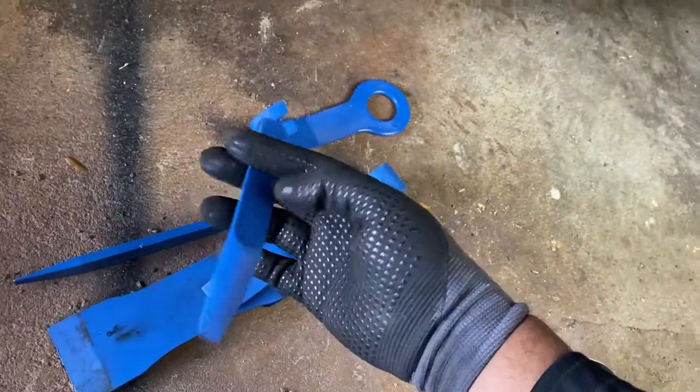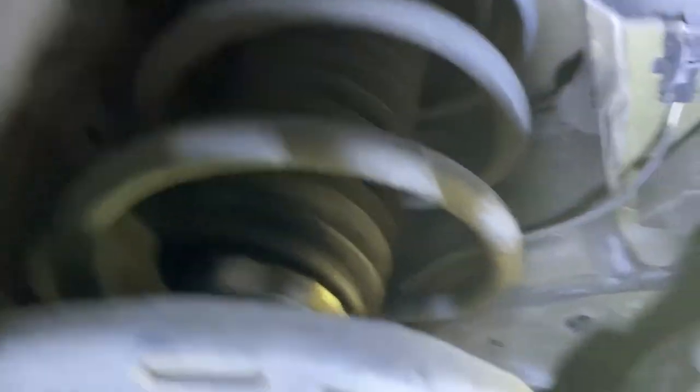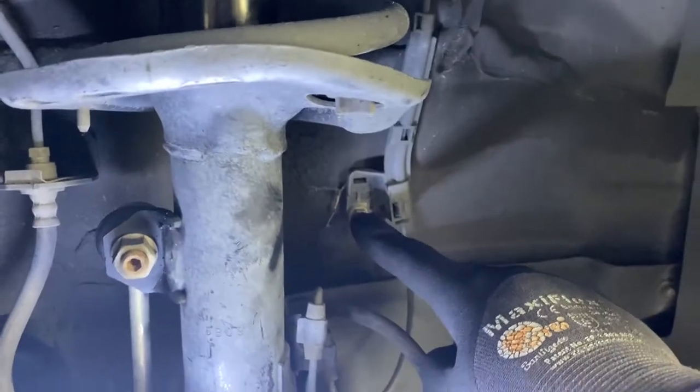You can peel this back. I'm going to try to peel this back without having to take all of this off. If you do have to take all of this off to make your job easy, you want to get yourself a set of these panel removal tools. I'll put a link in the description down below for all these — I think it's like 10 bucks or maybe even five bucks. But I'm going to try to peel this back as much as I can to get to that. I want to disconnect it there first because I know all of this is easy — this is just a 10 millimeter bolt.